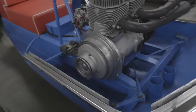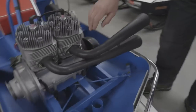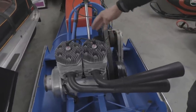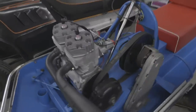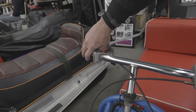And what Polaris did is they had to make a plate here to bolt it to the chassis. They made it free air, turned the head sideways, modified it, and used two HD carburetors on the side. And a very simple operation with one throttle cable going back and forth with a little wire in between the two, so it's synchronized up with the throttle.